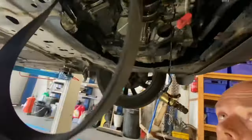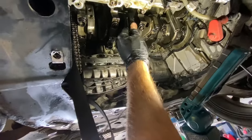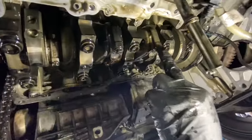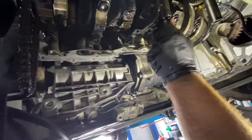And that's when it exposes the crank. Oh, there's your problem. Yeah, it's got hot as well - you can see the different colour. Give that a rock, Chris. Guys, that is the knocking that you could hear. Your big end has gone.